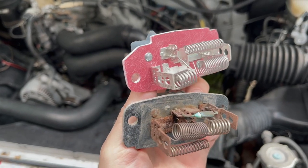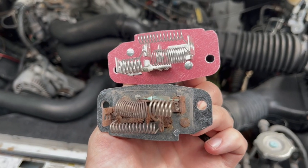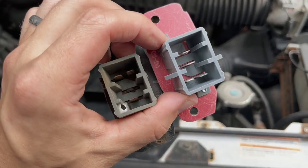Basically, you're not getting full voltage — it goes through these resistance coils, and less happens. So if one of the positions on your fan switch doesn't work, go ahead and pop this little guy out and take a look at it. You're looking for broken, damaged, bent, or deformed coils, and also the connections on the backside and in the female socket of the wiring harness.